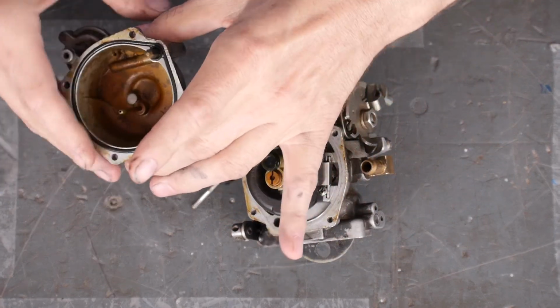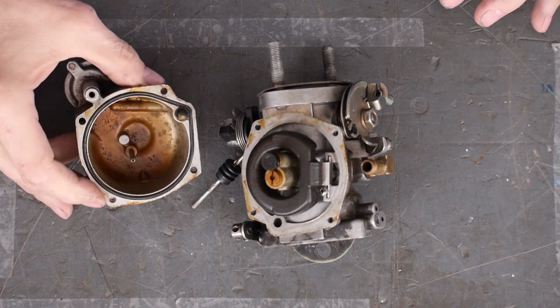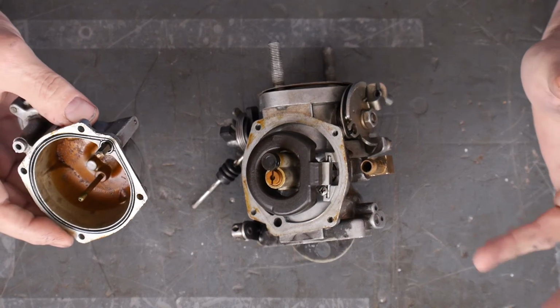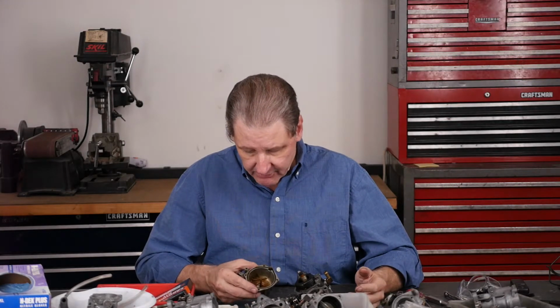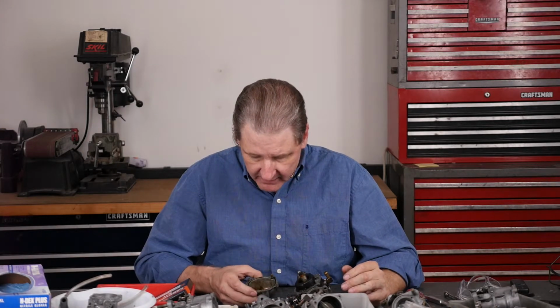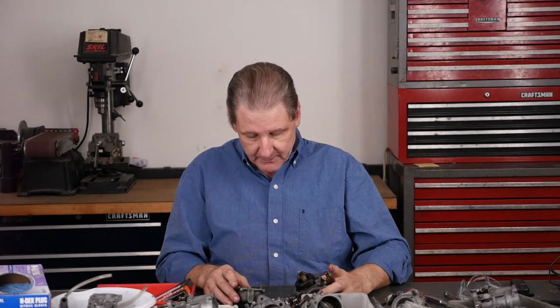Oh God. Yeah, lots of junk in there. All right, this is not good. I said in the first video, the tips and tricks, it's only been on for a couple months. Wrong. It's been almost a year. So in the hot Florida garage over the summer, the gas boiled out. And I bought gas at Racetrack. I'll never do that again. I'm not sure if it is the Racetrack gas, but there is a lot of crud in here. This would explain why the accelerator pump's bad.